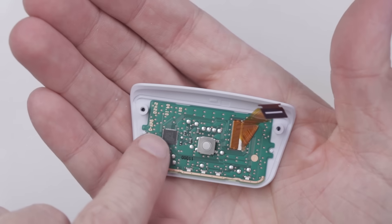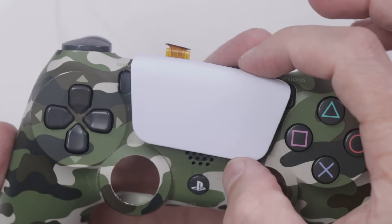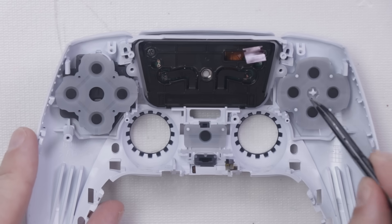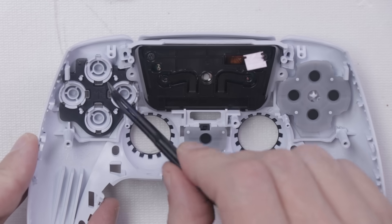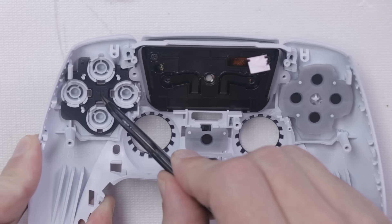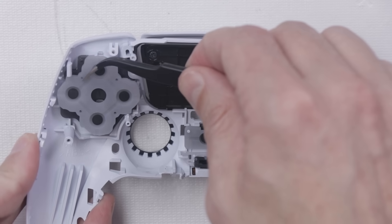This ribbon cable is soldered down right there. Then we have the main button right there along with a little chip right here. The touchpad on the DualShock 4 is definitely smaller than on the DualSense controller. The DualSense touchpad also has that angle on it. As far as the buttons and button pads, they're pretty standard, but I did notice something over here. On these buttons, they're sort of like a dual cushioning system — we've got a darker base cushion on them, and then button pads that go over the actual buttons.